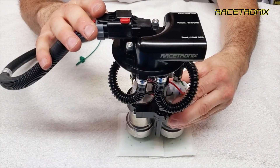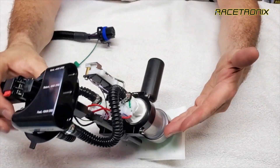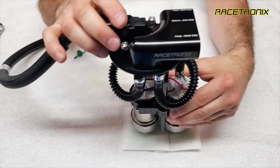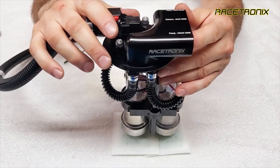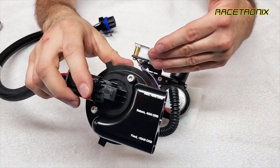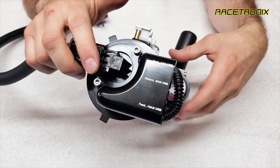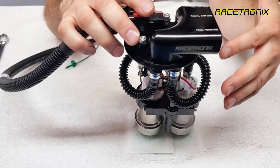This system allows for two larger-bodied pumps, like the Walbro 274, which is known in the industry as the 450, or the Hellcat 285, which is also known as the 525, to be installed in the tank. The modular design of this hanger allows each individual pump to be installed through the opening in stages, and then everything locks in place quite easily, allowing it to be assembled from outside the tank.